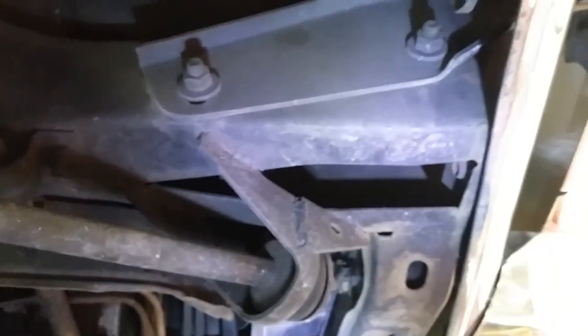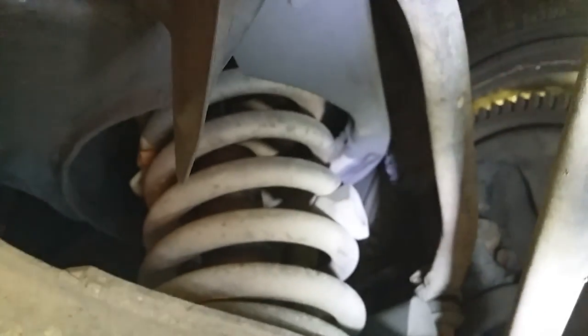We're underneath and giving it a good look over. The frame rail extensions up front look nice and straight — no evidence of damage going back, no wrinkles, no rips, no diamonds or distortions, all the way back to the spring pockets. Those coil springs are getting a little bit of help with some twist-in adjusters. The front end of the vehicle is an un-wrecked, original, solid structure. Inner fenders are really nice. The suspension is largely original — there may be some rebuild components put in here a while back. We have some seepage both front and rear main, and some coming down on that 425. This is an original numbers-matching 425, 360-horse dual-quad engine. Very few of them came equipped with that — less than 10%, I believe.